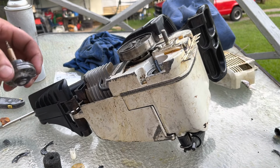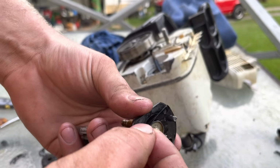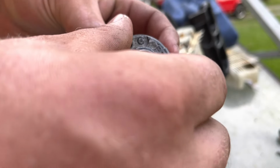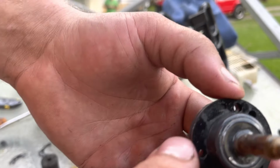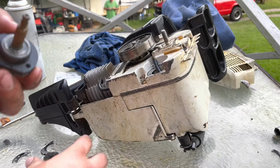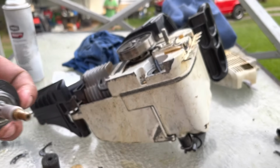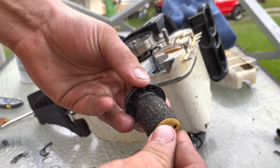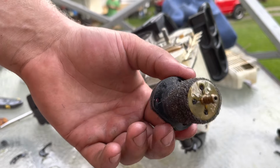All right, we're back. Okay, so got our gasket installed here underneath the diaphragm. Make sure your gasket goes down first, then your diaphragm on this side. And also be sure that you got that little spring in there, puts tension on your diaphragm. And then put your pump together just like so. Install your second gasket. And there you have it. And then go ahead and slip this little piece on. Be sure to have it lined up just like so, where your oil holes can get oil. Slip your sock or foam piece down on there. Then this piece. And make sure you push it all the way up until it clicks around that barb to keep the filter pushed up.